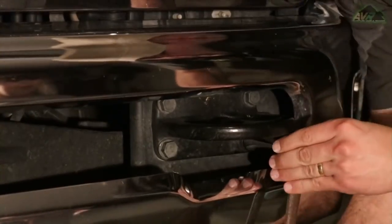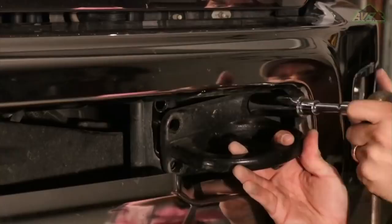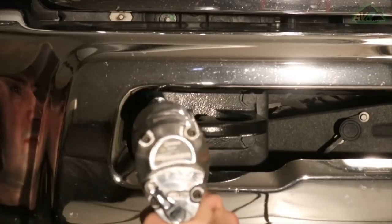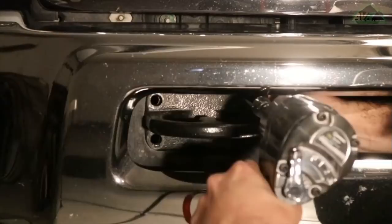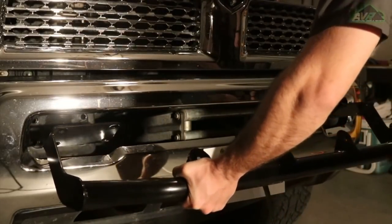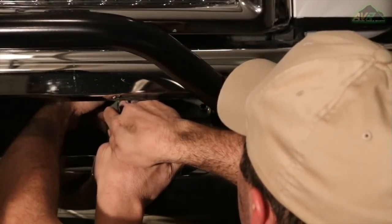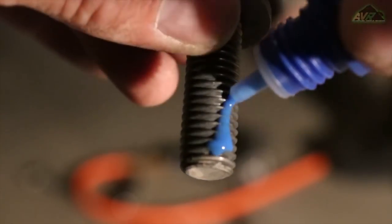Installing the bar is pretty straightforward. Simply use a three-quarter inch wrench to hold the nut located on the back of the tow hook, and a three-quarter inch socket wrench to turn the bolt on the front. A power tool makes the job significantly easier and much faster. Once the bolts have been removed, the tow hooks become detached from the vehicle and can easily be taken off. Using a buddy, gently install the Sleekster Light Bar inserting it slightly tilted to allow the bottom holes to enter the opening first, then tilt the bar up into the correct position. While your buddy holds the bar in place, grab the tow hooks and begin reinstalling them using the original factory bolts. It is recommended to apply a locking solution to each bolt prior to continuing.